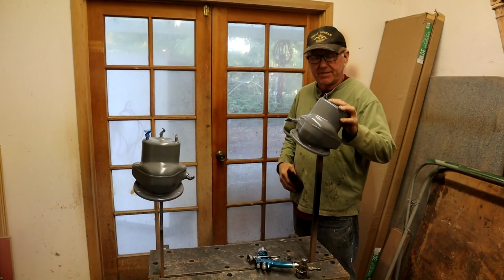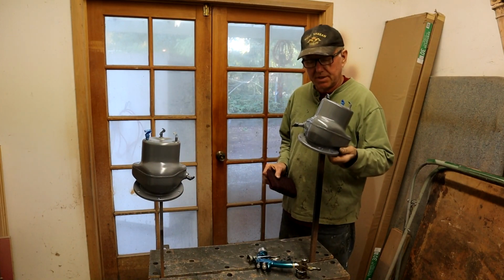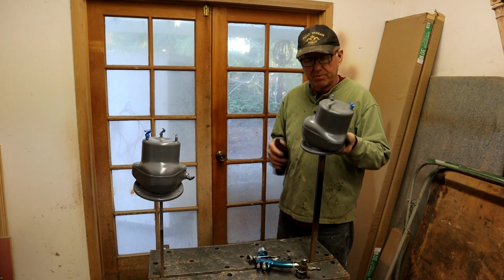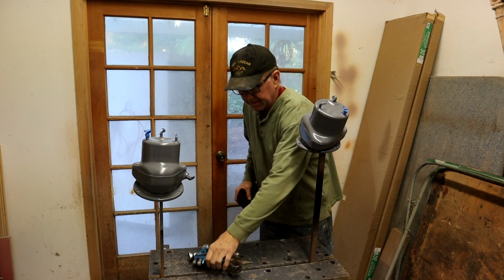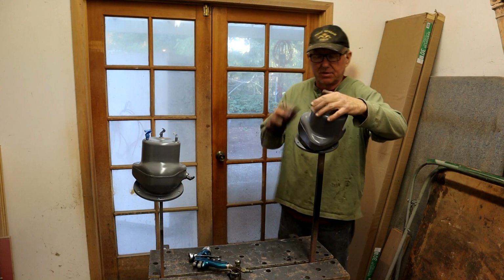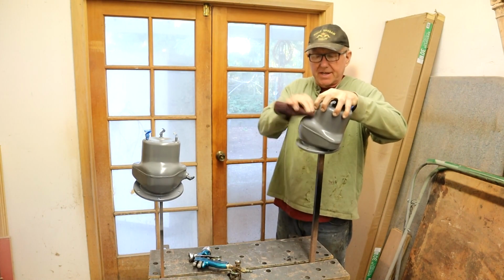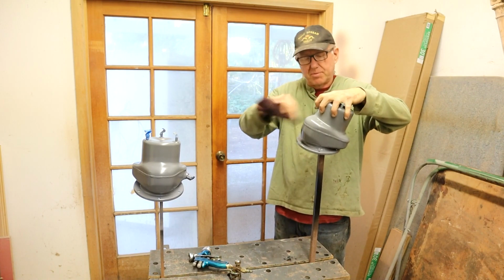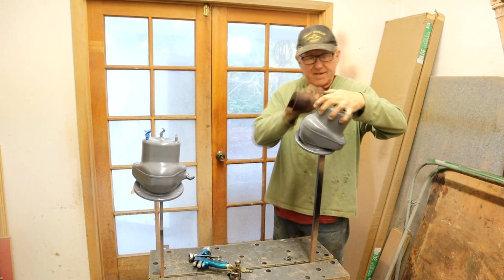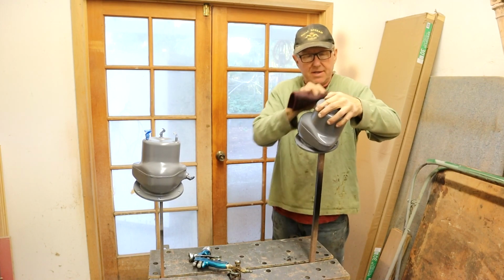Now onto the air tanks. I've had a couple of days to dry now. I think the window's around 72 hours for a chemical bond, and I'm kind of borderline on that. I think I'm just below it, but I'm going to give them a little scuffing just to knock the sheen off, just in case. Just got a fine Scotch-Brite here, just to scuff the surface, make sure we're going to get a good mechanical bond with the top coat.